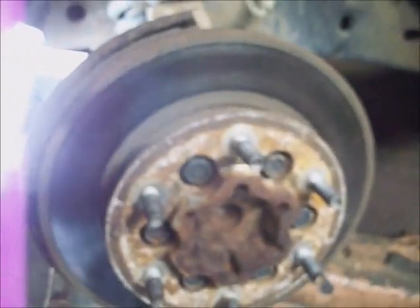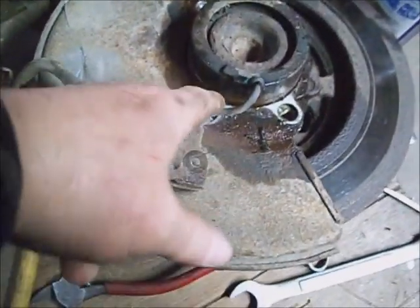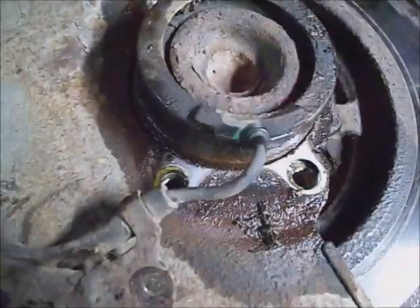Like an inch thick one. Go ahead and slip it out of there and feed that ABS cable through the hole in the back. Pay attention to your ABS wiring that is between these two upper bolts, and that the shielding will have an open gap for the caliper to set on it. Of course, the bolt holes are oblong, so it's kind of hard to mess it up, I guess, but there it is.